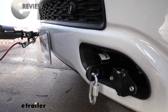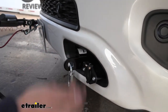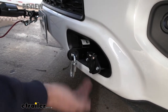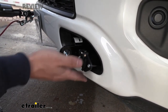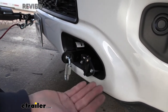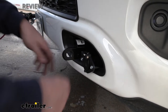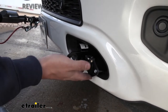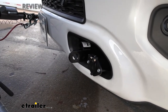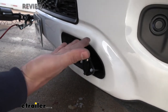The only things that really stick out are the parts that need to be. The safety chain convenience hook has to stick out a little bit from the bumper because when we go to hook up our safety cables each time, we don't want to be banging it into the bumper and scratching the paint. Our electrical connector also needs to stick out a bit so we're not hitting the painted bumper each time we make our hookups. But aside from that, everything has a pretty sleek installation — recessed behind the bumper. Overall you wouldn't really even be able to notice it when just driving down the road. It is hidden back there pretty far — definitely a factory-like finish.